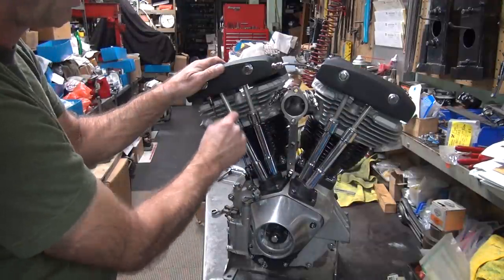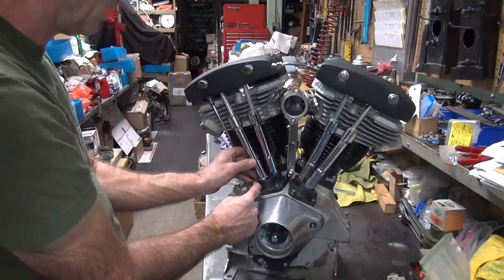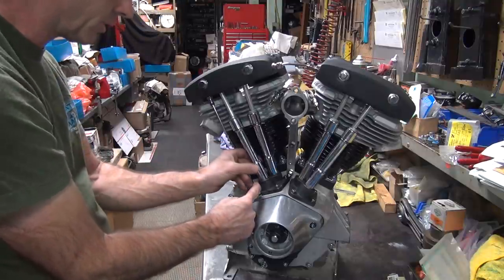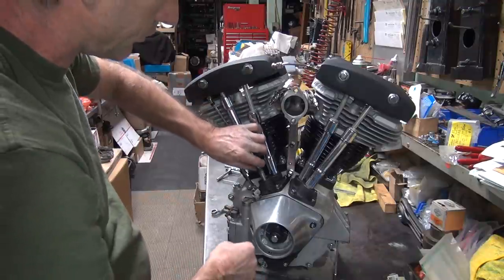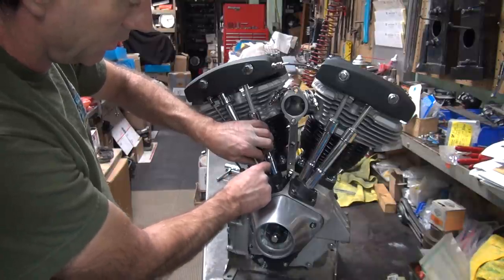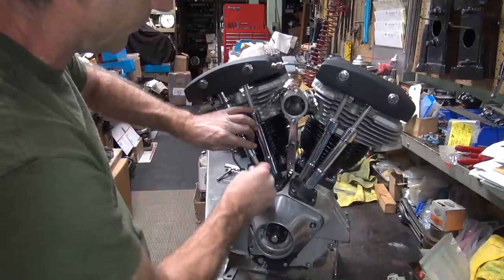See, they're both loose. They need to be adjusted. See, that goes down a long ways too. Alright. Shove it all the way up that way. See, it gets loose. Then you can adjust the lower one down until it touches. Right there. Then you got a jam nut right here. Run it down to the bottom. That one's already adjusted almost.